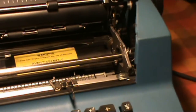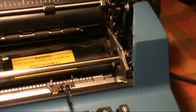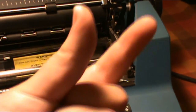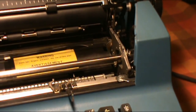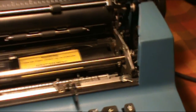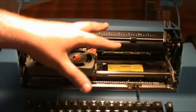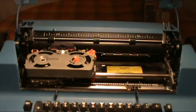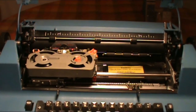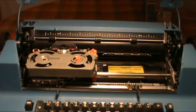The drive belt is guided through a pulley located on the outside of the main frame. It is adjustable and has springs that allow the tension to fluctuate. Because it's partially made of plastic, the plastic has deteriorated over the years and broken off. Using this machine wouldn't be wise because if those cords come off and get tangled up, the machine will be useless. It already has problems because the backspace doesn't work — it can't get enough tension fluctuation to pull the carriage over one space.